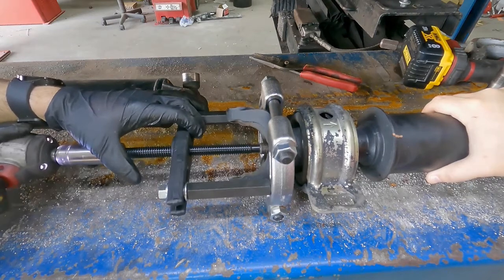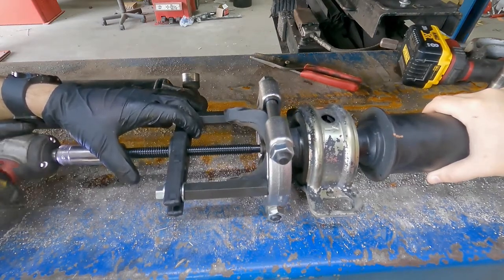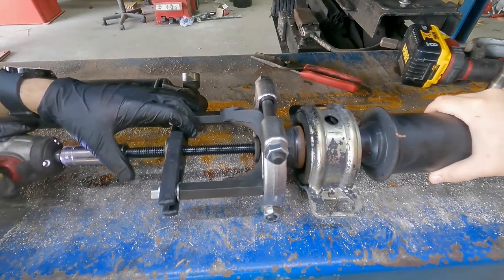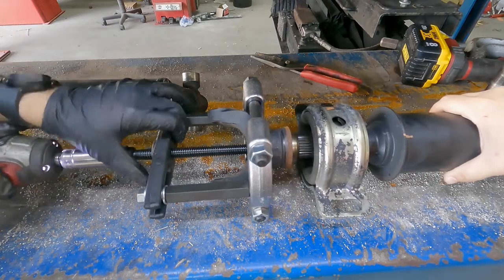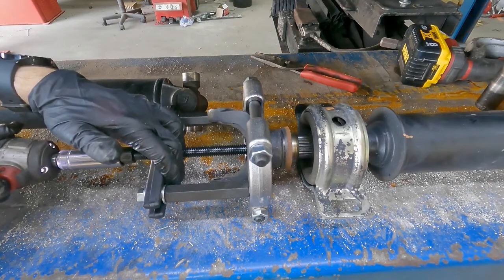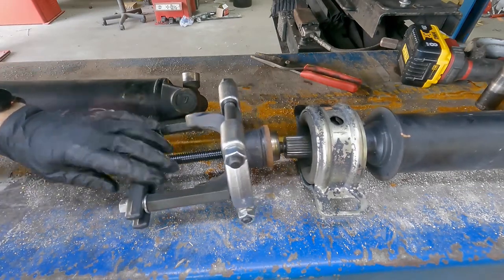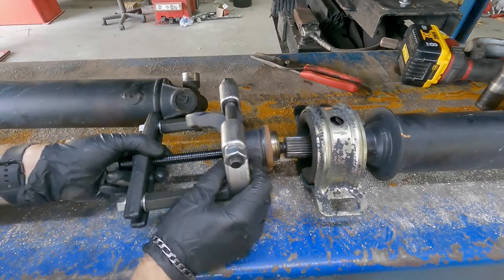It's coming. Notice how John didn't just start wrenching away — it was little short bursts to make sure nothing was binding, because if you do that too forcefully and it gets stuck or caught up on something, you're going to break something.